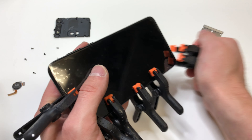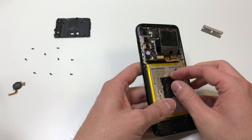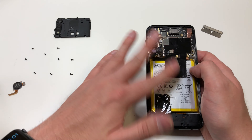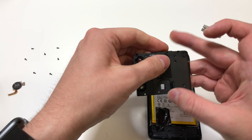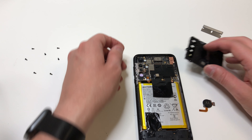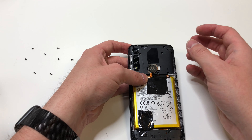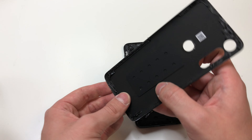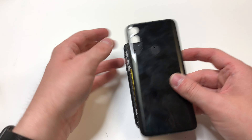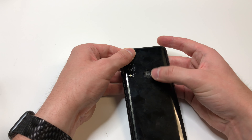To put the phone back together, plug in the battery and make sure it fits properly — I'm reusing the adhesive on the battery, but feel free to replace it if you took it all off. Put the little black piece back on, then push down the top black piece as well. Remember to put the fingerprint scanner on — plug it in, fold it down, put the little black panel on, and set the fingerprint scanner in place. Put all the screws back in, then remove the old adhesive from the back of the phone and add your own adhesive where you found it. I didn't replace it because I was testing the phone, but I highly recommend replacing the adhesive.